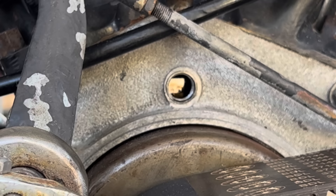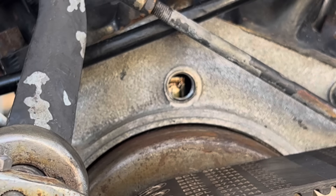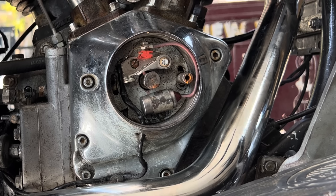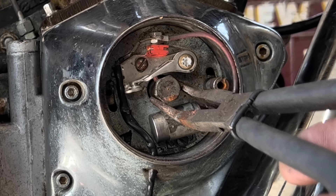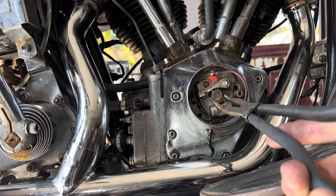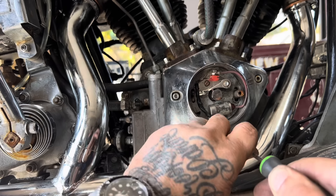Normally it's just a vertical line without an F - somebody's marked it. With my front cylinder on the compression stroke and my flywheel timing mark in the timing plug hole, I need to roll the advance unit cam counterclockwise to the full advanced position. With my advanced unit cam rotated counterclockwise in the full advanced position, the circuit breaker points should just be beginning to open - and they're not, which means my timing is retarded. To fix this, I loosen my plate and advance the timing some. You advance the timing by moving the plate clockwise. I tighten it down and try again. Sometimes it's easier to take the condenser out of the way when you do this.